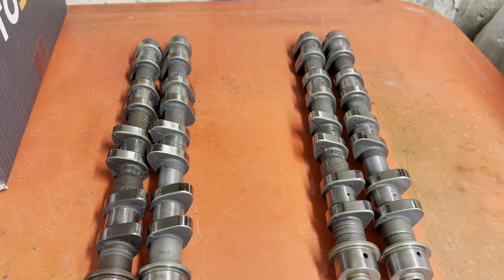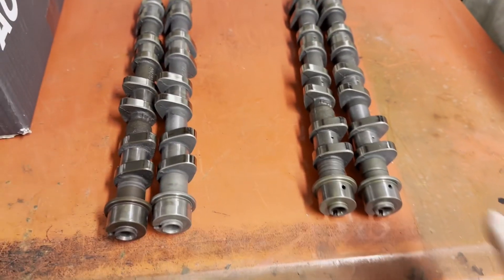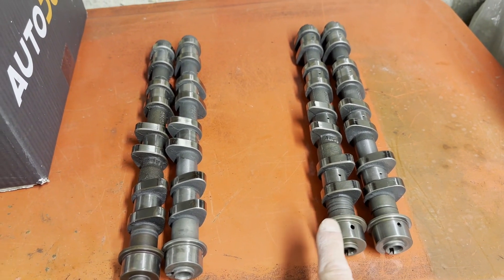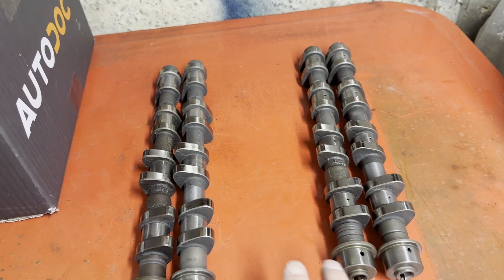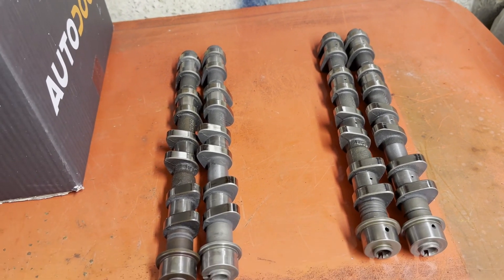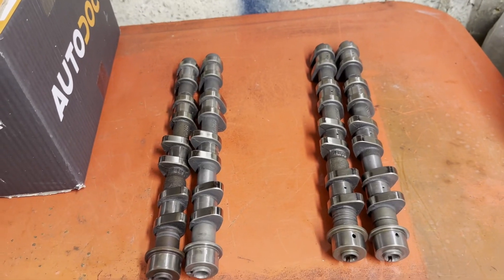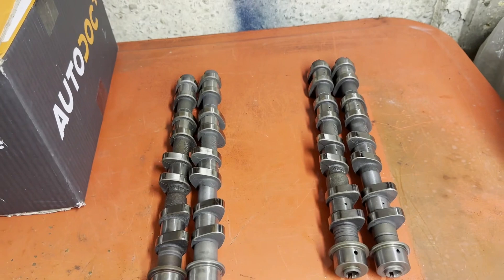The theory I'm going on is to get the RS cams set up on my head, get all the clearances checked, and then get another set of clearances done for the LT cams — so that I can mix and match: try an LT inlet with an RS exhaust, an RS inlet with an LT exhaust, two LTs, two RSs — just to see what gives the best performance for my engine, because not too many people have done the long stroke 16-valve route. A lot of them go short stroke because it likes to rev, so I've done something different.